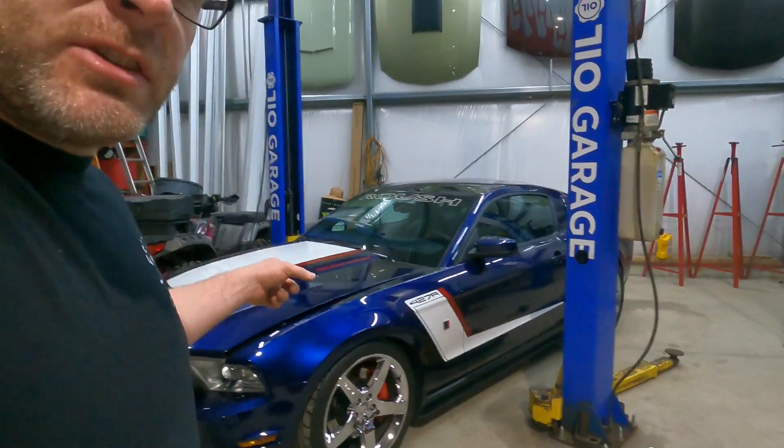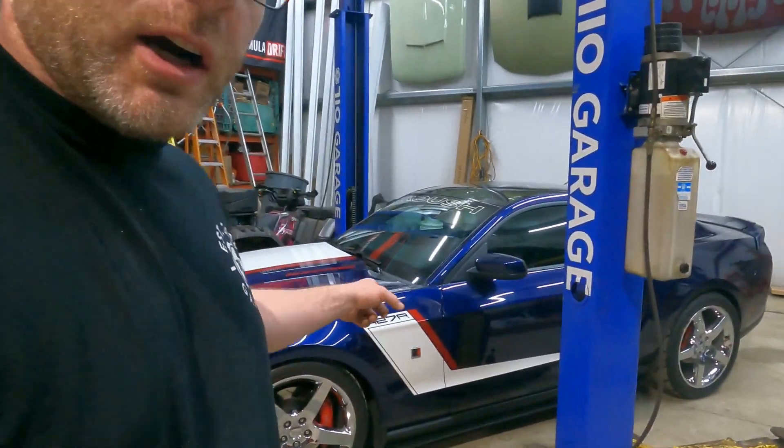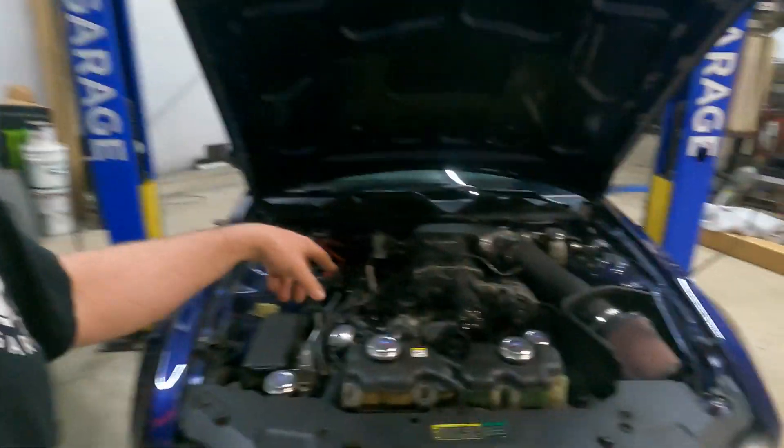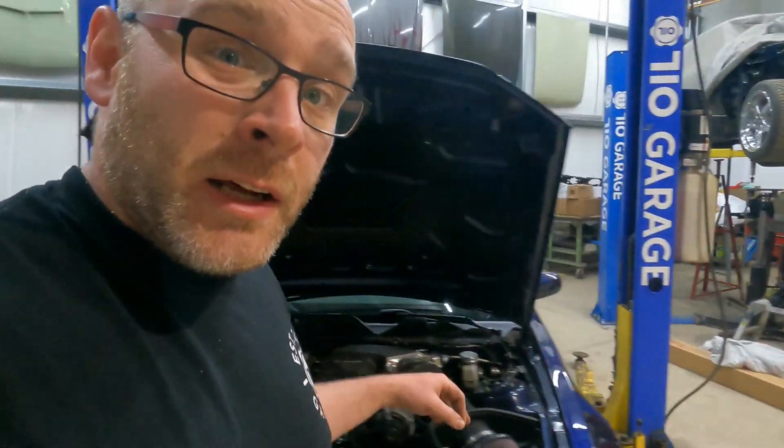This thing is a 2010 that originally started as a 427R car. He did a couple of little modifications to it — I'll put the VMP video in the description below. If I could open the hood here — yeah, this thing makes almost 900 horsepower, and that was too much for the stock transmission to hold. Around August or September of 2022 he came in with a broken input shaft. He was racing a Hellcat and the input shaft decided to leave the chat, so he brought it in and we yanked it out and put a new input shaft in the stock transmission while he waited for the T56 Magnum to show up.